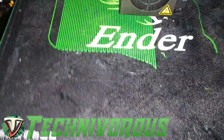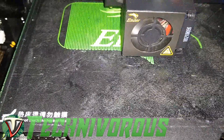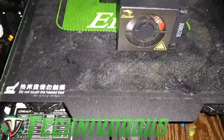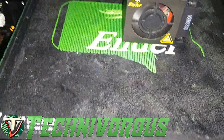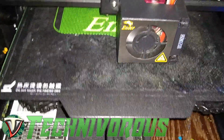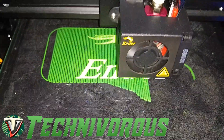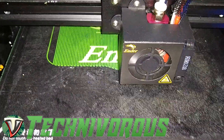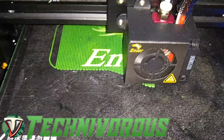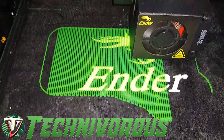And as you can see, even yesterday we were running smooth as silk after changing the nozzle and the extruder. I am feeling even better about this now because I was noticing some weird stringing on some of my models, and I realize now that that was coming from the leak in my hot end. So you live and you learn. If you guys have the same mistake or leaking around the hot end, it's very likely that the nozzle is not seated properly and it's causing it to leak between the nozzle and the heat break. So take it apart, definitely turn your machine off, wait for things to cool down, pry it apart, bust out all that plastic. Seat the nozzle about a millimeter away from the actual hot end — you don't want it all the way in — and then go ahead and adjust your heat sink.